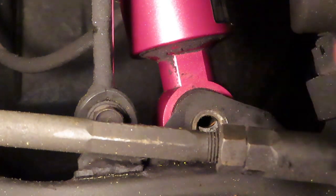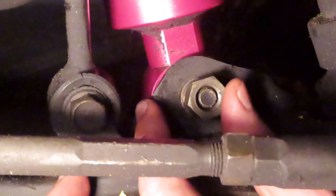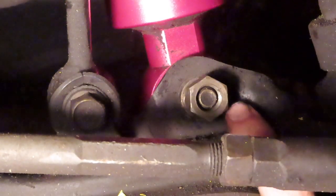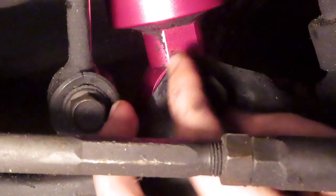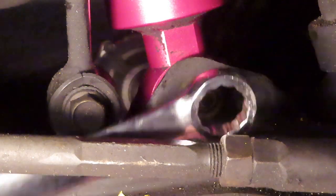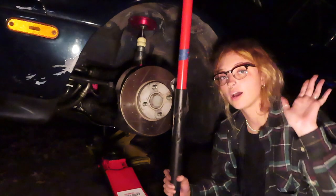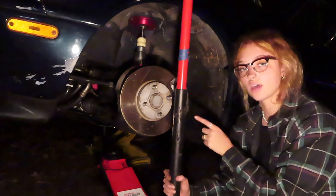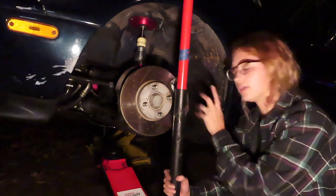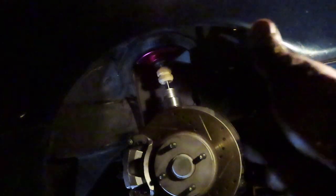This side of the bottom of the coil is angled up and in, so you want to make sure this is facing the right way and then it'll slide right into place. We're going to tighten up the top hat bolts and then put the bolt through the bottom, and then this side will be done. Once you get this long bolt threaded through the bottom of the coil, you're going to put the locking nut on. Once it's threaded down by hand far enough, put your wrench on this side, and then you can ratchet down the opposite side. Now we're going to mirror everything on the other side. Side number two, all done.